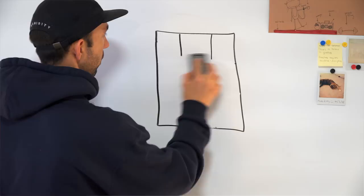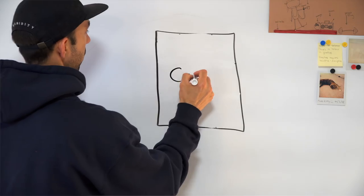You can always take more wire off but you can't really put it back on, and if you accidentally take too much off you've got to order a new static screen, wait for it to come — it's a huge pain, just not fun. I'd also recommend only doing this if you need to do it. Be aware that on this sliding scale of spraying to clumping, the more wire that you remove, the more clumping you remove, but the more spraying you will get. So your grinder will potentially be a little bit more messy — it's just part of the game.